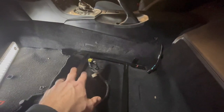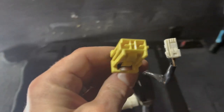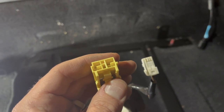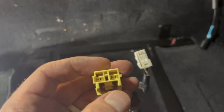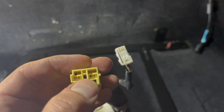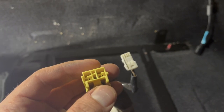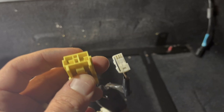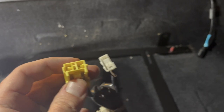I'm going to see if I can find some resistors to show you what I'm talking about with the airbag. For some reason I can't find them — I had a whole envelope full of them. Check out my Q50 Sparco seat installation video where I go through the whole thing. A resistor provides the ability to jump those two little pinholes together — it tricks the system to think it's plugged in when it's not. It's when that resistance is no longer there that the airbags blow.